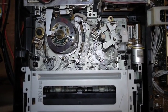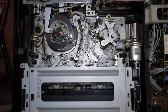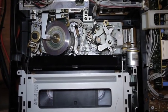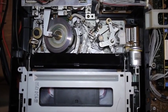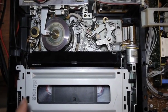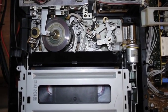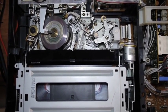After you have placed and aligned the gears on the bottom side, you should be able to insert the tape properly. As you can see, the half load arm on this side is able to load the tape, and the two split arms are able to load the tape next to the head drum. When you eject it, you should also eject without leaving the tape on any part of the VCR.